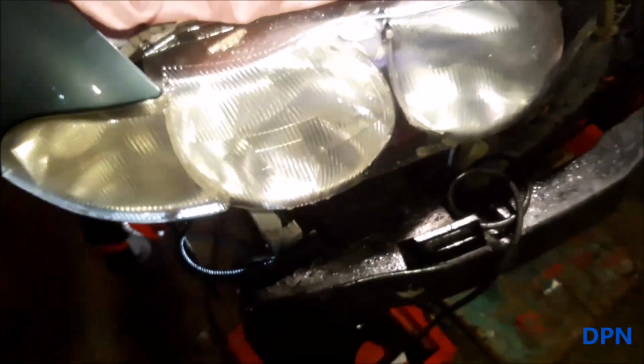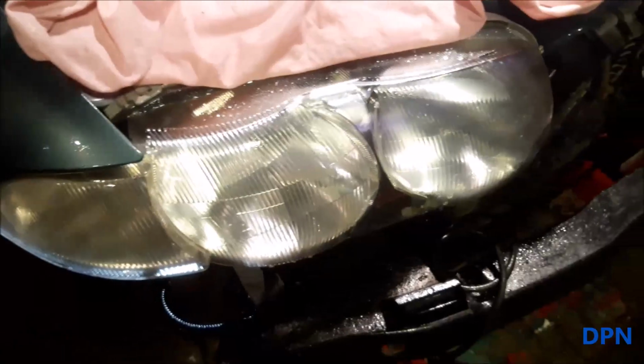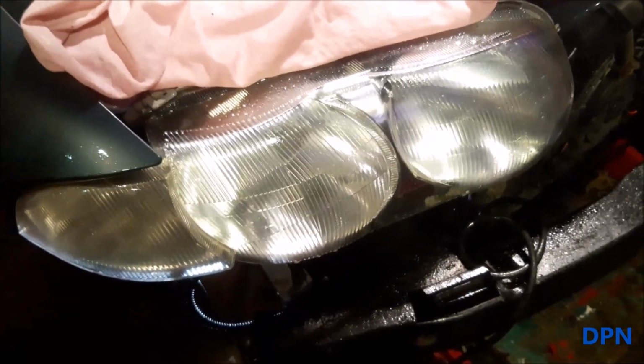And then what we do is spray the lights over with a little bit of soapy water, keeping them wet all the time, not to really dilute the compound polish, but just to make sure it keeps flowing and doesn't dig in or really sort of compound too hard.